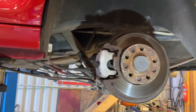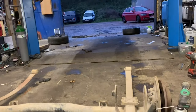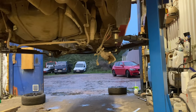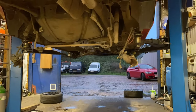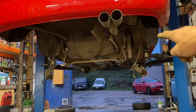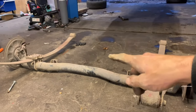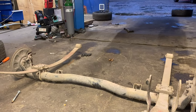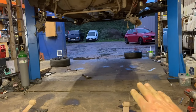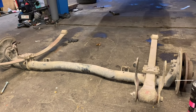One more bolt on the front leaf spring and let's get this rear axle on the floor. We've got the rear beam off. Before you go undoing any brake cables and stuff like that and hoses, just unbolt the cables and let them hang - a lot easier. Unplug the ABS sensors, undo the two 13s, pull the two calipers out and let them hang down - no bleeding, nothing, nice and easy. I've left the anti-roll bar still on there and the shocks on there for now. The strategic way I did it: I undid the rears, let it hang down so it touched the floor, then once it had taken the load I undid the front two and carefully lowered it down. Two people would make this job a lot easier, but not too bad at all - probably took about half hour.